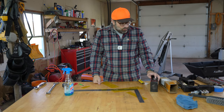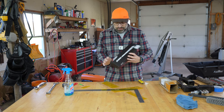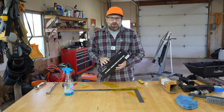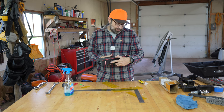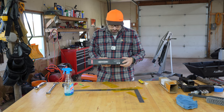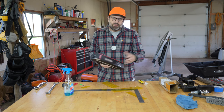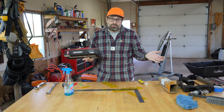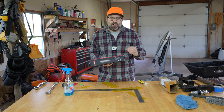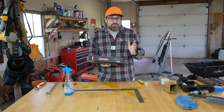I got these four wheel drive king lights and my only worry about these was how white they were — they are super white, 6500K, which is pretty much the whitest you can go. If you don't know, the higher the number the whiter it's going to be. A 3000K light is something you put in your living room, something that's not harsh. 6500K is super white, very harsh.